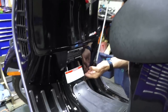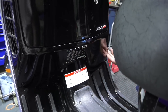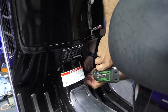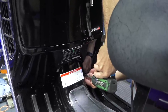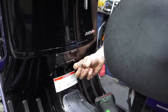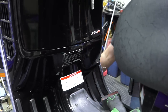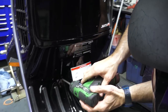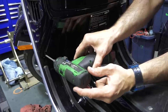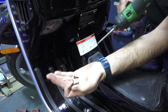Down below you can see the glove box has popped off. There's going to be a clip under here, normally attached to the floorboard, but when they got in a wreck it kind of pulled this all away — that screw's already missing, I'll have to replace it. I noticed somebody put the wrong screw here; this should be a screw about half the size, and that's kind of dangerous because there is a coolant hose that runs there. When I assemble it I'll show you the correct screws.